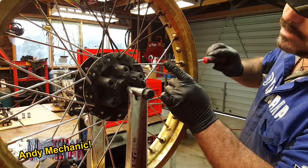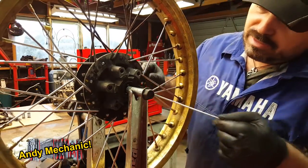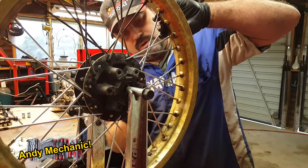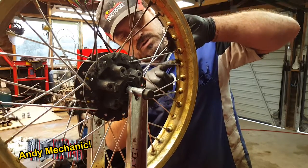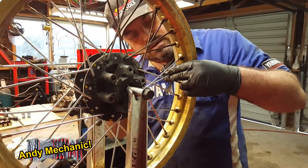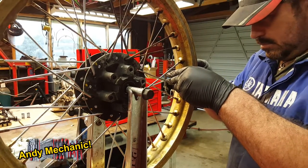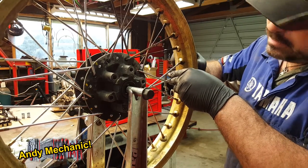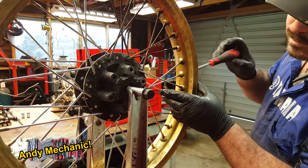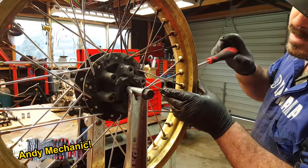Getting so hungry now. Right. Okay, so we've got one more white, which is a 90 to go. And we thread that through from this side through there. And then. Now, his buddy is this one here, so we get to the rim and then count four. One, two, three, four. And that tallies, it's the last one left, so it's a good double check. Bit of thread lock. Cool. Get a nipple. Pop that on there. Cool. Only eight spokes to go! Whoop whoop!